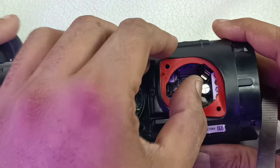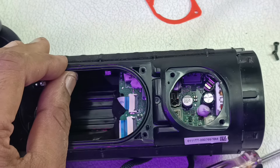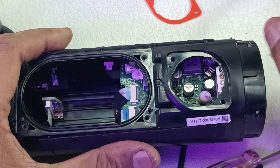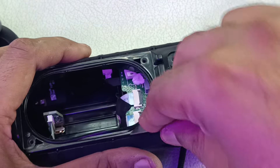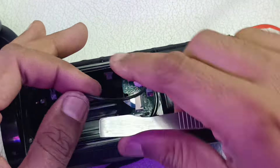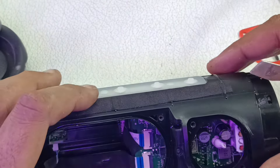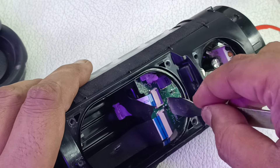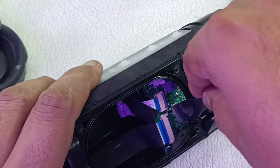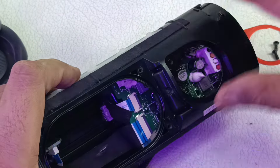To take out the battery we have to slide the motherboard out a little. These packings here are very important — after the teardown, if you are replacing, don't forget to put this air seal and the seal for the port here. You have to keep these carefully, otherwise a crackling sound problem will come. Now I'm going to lift these two sockets so we can take out the two flex cables.